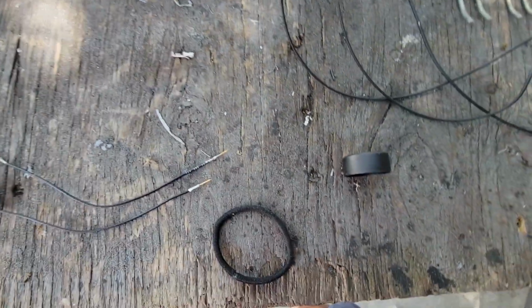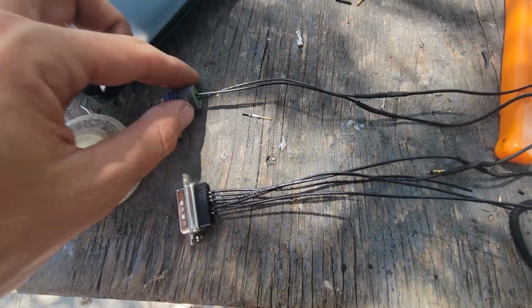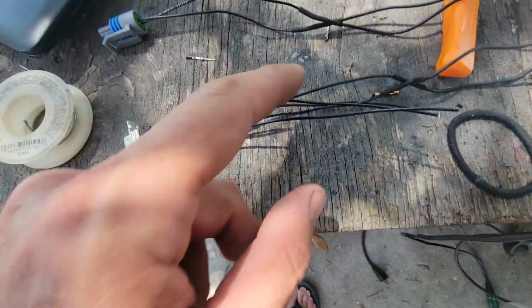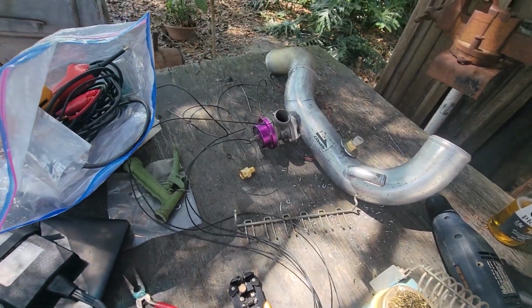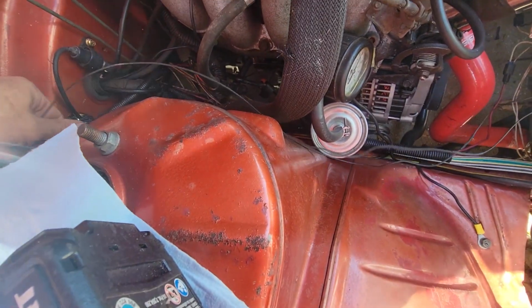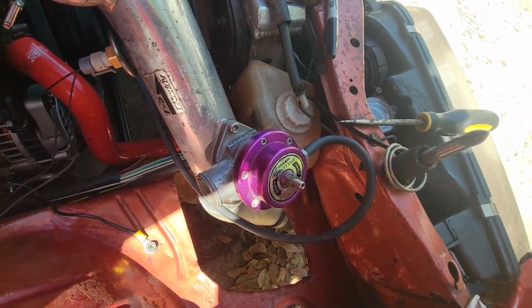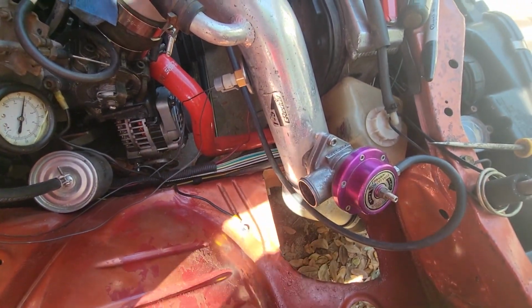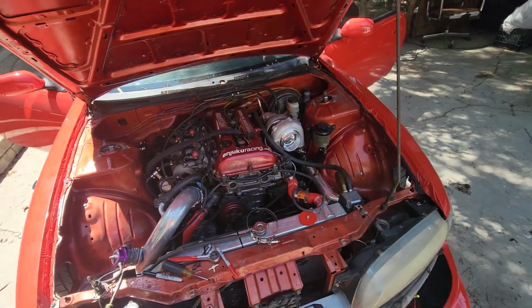And I'll have two wires and they are going to connect to the serial connection on 20 and 22. Well, I'm not sure how they were intended to be connected, but I just did it the old school way, with some solder and heat shrink. So let's plug it up. Okay, intake air temperature sensor hooked up. The wires are haphazard for now because we're just trying to get it to run, clean it up later. Piping's hooked back up, flow valve hooked back up. I think we're about ready to try a crank.